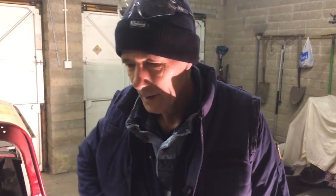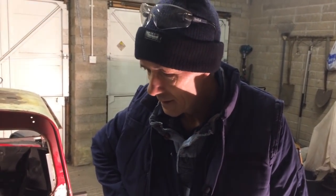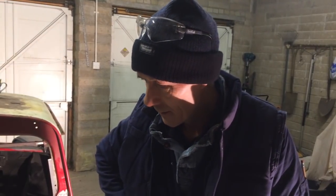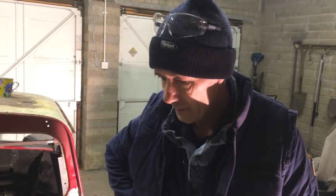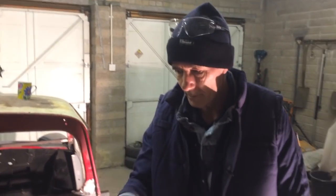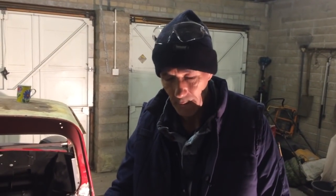I'm definitely going to do something about those flanges in here. I think we've discussed it the last time. I think Piper, Doug and Davey and all the rest of the boys decided to return the flanges on the other side. So that's definitely what we are going to do. We can't do it with that cross member in place anyway, so we'll do it before we do the final weld. Because we need to take the back cross member off to allow us to put that return flange the other way round.